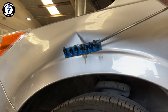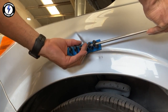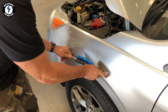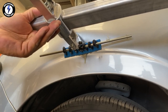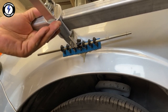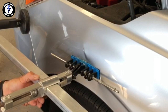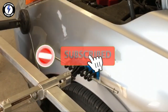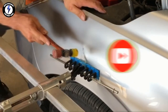The glue is dried and ready to go. I'm running my pen through the tab. Now it's time for my second step — I'm attaching my dent puller to the tab. Both puller legs are in place and ready to go, my hook is around the pen, and you can see the pulling power action taking place.